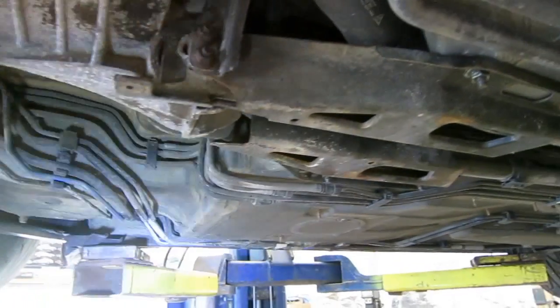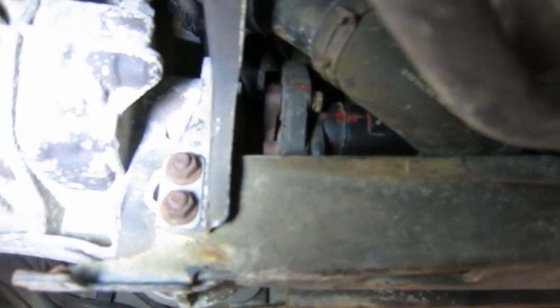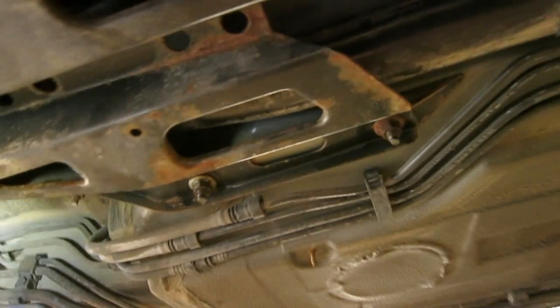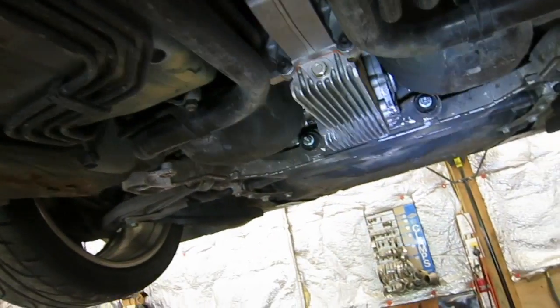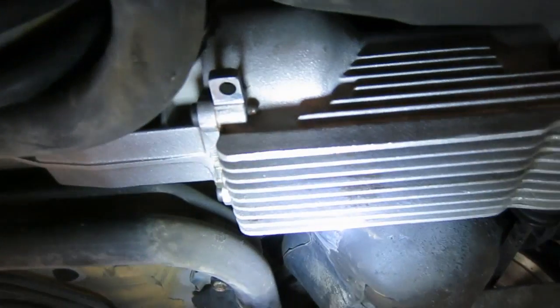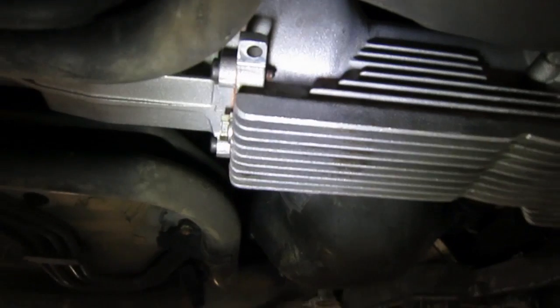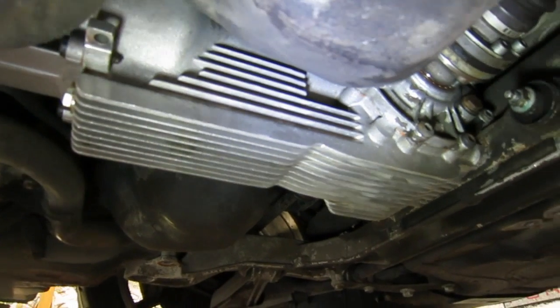This one, because it's the C4 model, I'm not quite sure how visible it is, but there's actually a drive shaft. There's a rubber kind of donut bushing between a part that's coming out on the front of the transmission and this black drive shaft here. Maybe here's another view to see it. So this drive shaft transmits the power to a little front differential, and that's this shiny aluminum looking thing. Actually, there's a viscous coupling right here in that housing, and that viscous coupling allows for a little bit of slip. I think the Porsche factory said that 85% of the power goes to the rear wheels and 15% goes to the front, or 75 and 25, something like that.